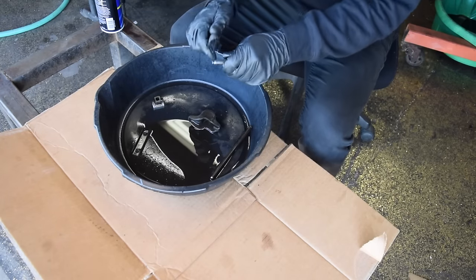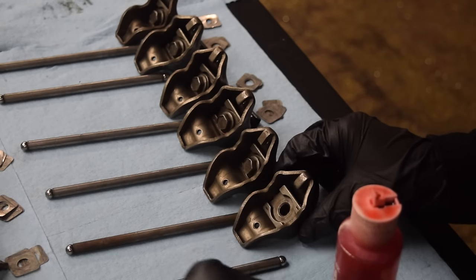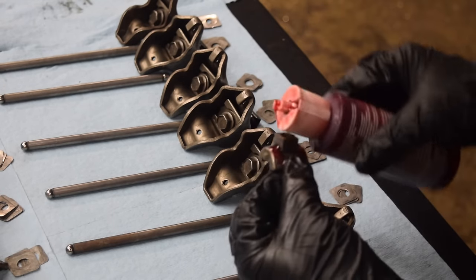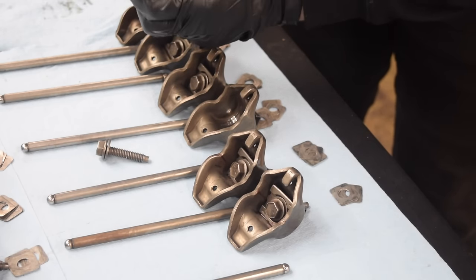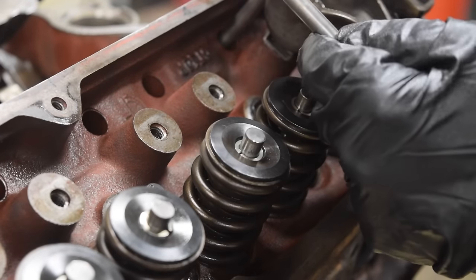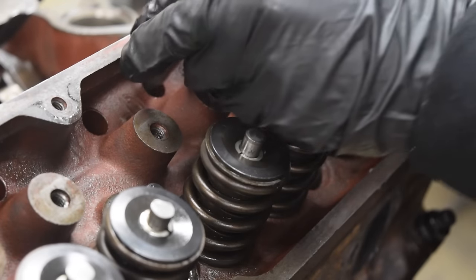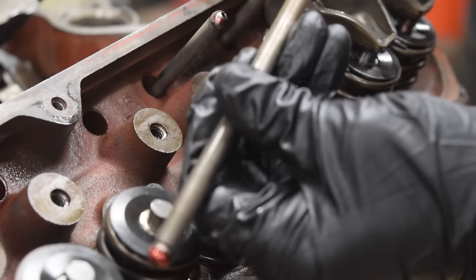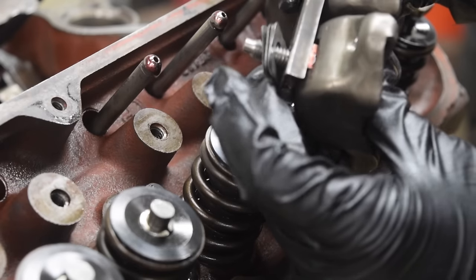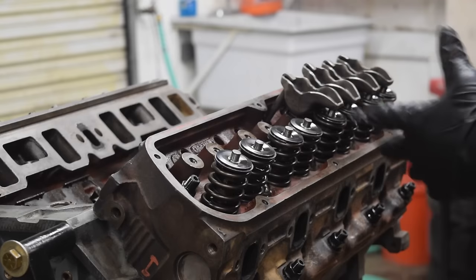Our rocker assemblies are now clean — you can see all the crud and schmoo that was on them. Before I install them, I'm going to lube up this pivot ball right here because once it is installed it'll be a bit harder to do so. Some of you might think this is overkill for an engine that's pretty worn already, but overkill seems to be the theme today. With all the pivot pins lubed up, we're going to continue adding assembly lube to everything that will need it — like both ends of the push rod are a good place to lube up. You definitely don't want to add too much because you might clog up the oil holes since this stuff is super thick.